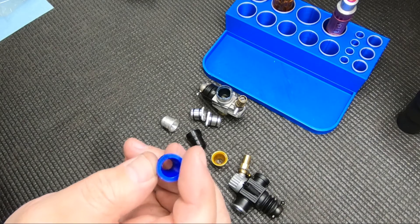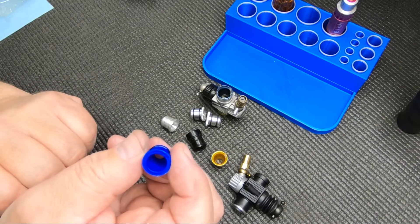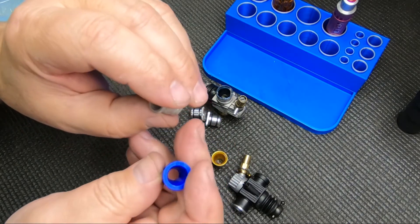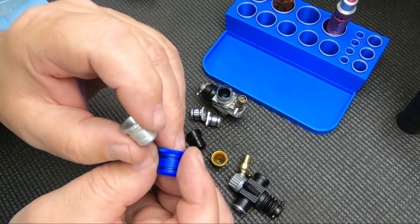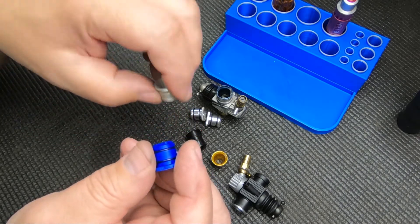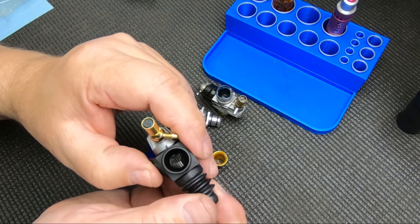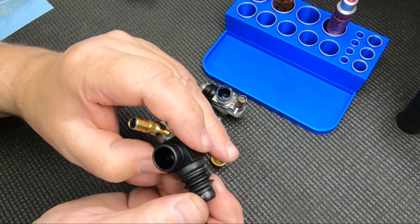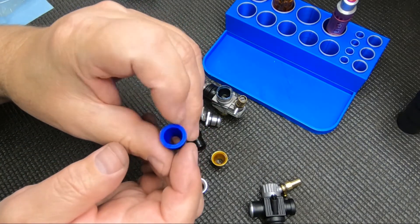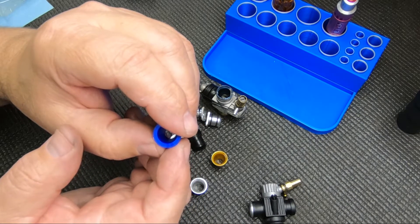I made some restrictors quite a few years ago — like five or five-and-a-half millimeters — and I didn't see a gain; probably even a loss in mileage. What I was seeing was that you were in the throttle more because the engine had less power, so you were opening the throttle more around the track. I found anything really under six-and-a-half tuned funny: the engine got kind of warm, didn't make any power, and the fuel mileage didn't get better.